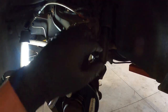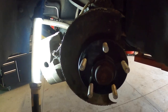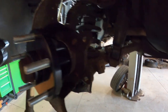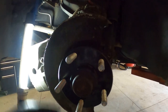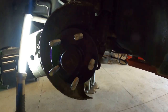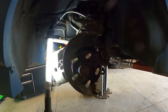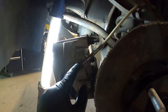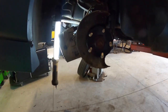I was going to town with my tin snips, and then I thought, wait a minute — you have your plasma cutter home, finally. So I zipped that off with the plasma cutter, then bolted it back on, bolted the hub on, got the nut torqued down the right way. We got no play but it's not too tight. Got the cap on it, we're ready to go. Now we just have to get the rotor on it, and then our adapter bracket for the caliper is bolted on. Then we can bolt the caliper on, and once we do that, we can take this bolt loose for the brake line and bolt up the new caliper. That way you don't leak all your fluid out while you're doing all this.